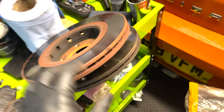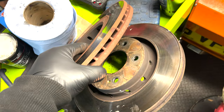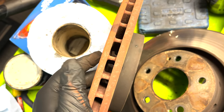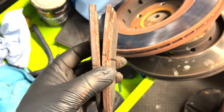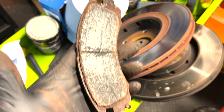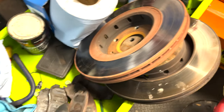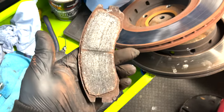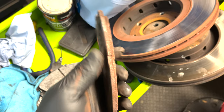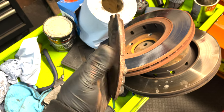So here are the two discs again - you can notice the discoloration there. This is the front left where the caliper was seized. Still puzzled about how the disc is thin on the inside rather than the outside - the outside is thicker. Never seen that before. And here is the pad for the left hand side - as you can see it's wearing super, super thin. Obviously the heat is kind of destroying the material there a little bit. You can tell the difference - this is the right hand side, pretty much new and wearing nicely. This one was wearing a little bit wonky as well, more at the bottom - obviously the piston was seized, probably at the bottom position.